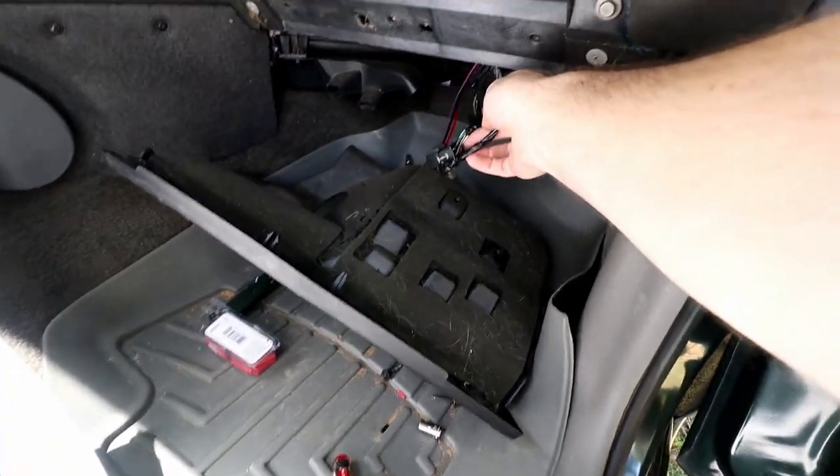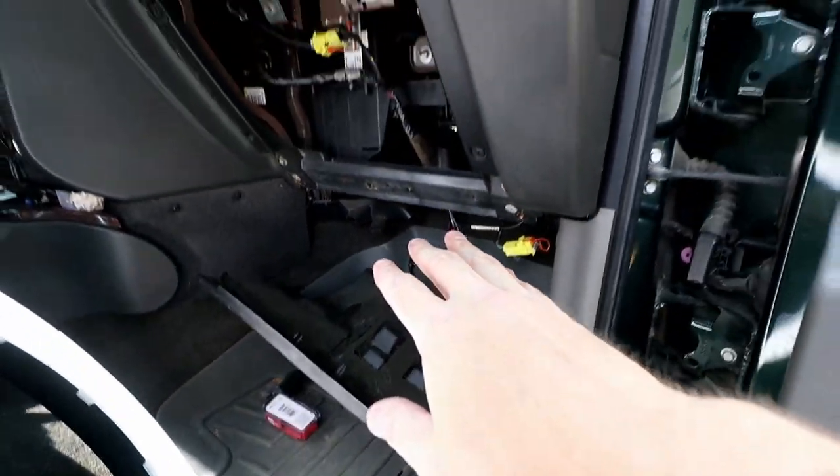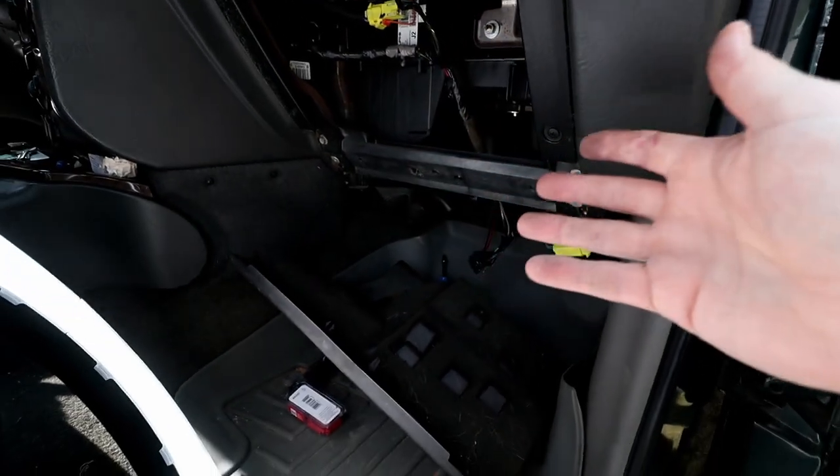That was a success. It was, in fact, the blower control module that had fried or short-circuited — whatever malfunctioned — and just replacing that did the trick. I will have a link in the description below to that GM replacement part. It's going to be a little more costly than some aftermarket products, but with 333,000 miles that original GM blower control module had lasted this long, so I figured might as well spring for the GM part again. Now all we've got to do is get the wiring harnesses put back on the access panel, get that and the glove box back in place.